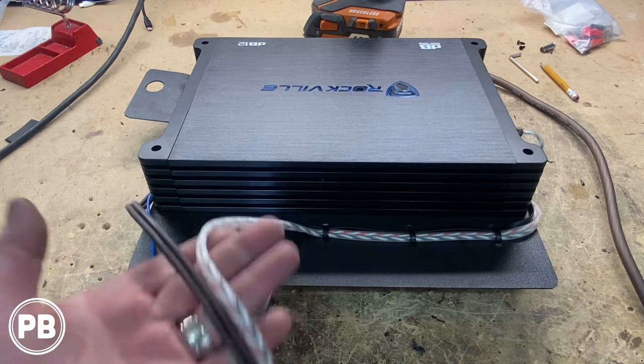All right, so let's show you all these connections we made with our line-out converter. So starting with our line-out converter here, the red and yellow wire goes right into this corner pin harness. And we strip the wire back without breaking it and solder on our wire there. Now we're gonna tape up that connection so it's nice and insulated. But that's constant 12 volts. Ground, as we put that ring terminal, it went right to that ground and zip tied it up. This loom there. So we got a factory ground right there, nice and clean.